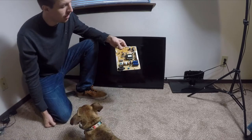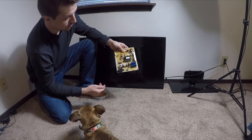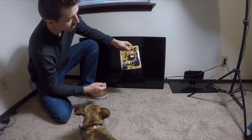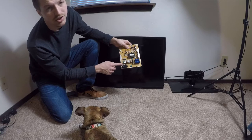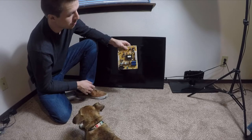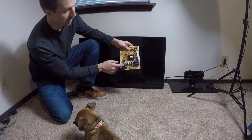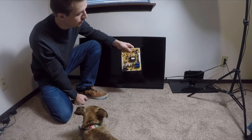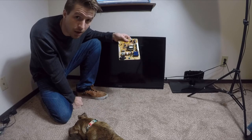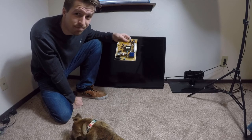As you can see, mine got cooked, so I went ahead and tried replacing the board, and in this case it didn't work out. I think whether or not the fuse is blown is a good indicator of success: in a good situation, the fuse would blow and save the majority of the board and the rest of the TV. But if the fuse is intact, there's a good chance a lot of power went through the whole TV and cooked everything. That may just be where you want to start, but I could be wrong. If this video helped you out, leave a like and a comment, and be sure to subscribe — thanks for watching.